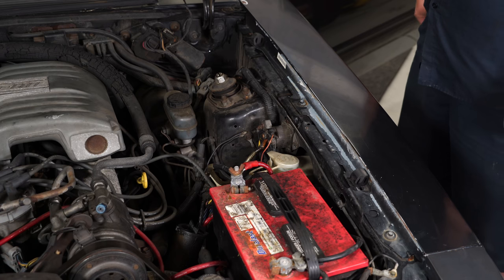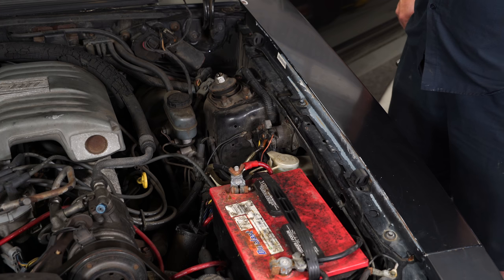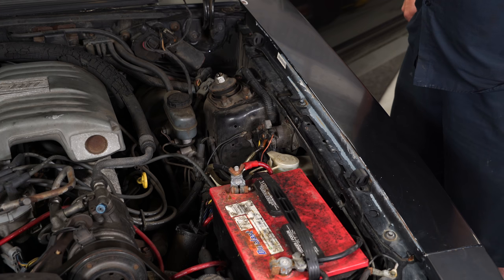When it comes to wiring the cluster, if you can wire up a car stereo, you can install a Dakota Digital cluster. The first thing we're going to do is make the three main connections we're going to need: a constant power, a switched power, and a ground. We're going to have constant power from under the hood - make sure you add a good 10-amp fuse on it, then fish the wire inside to wherever you're going to mount the control box.